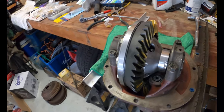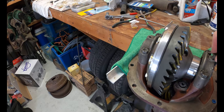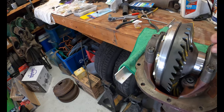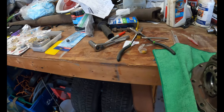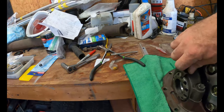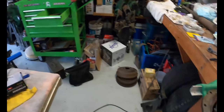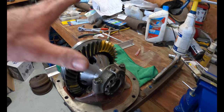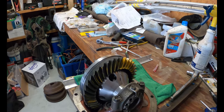Oh, I did take the adjusters off because I did tighten down my adjuster screws. So I will have to get those on. I almost forgot about those. And retorque them down. But I am happy with it. I'm going to torque these down and then I need to finish working up on the backing plates for the brakes, and I got all the brake stuff coming in, but the next video will be me installing this along with the lube locker and getting that all set up and then getting ready for the brakes.